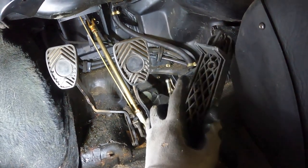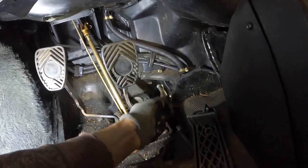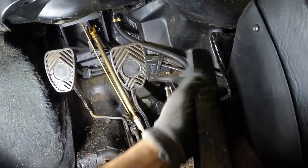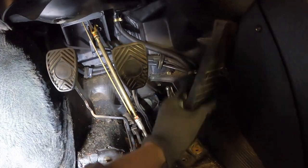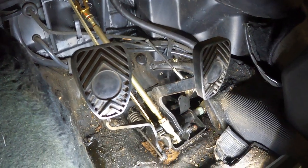Enough talking, let's tear these out. Here's your pedal — on the back of the pedal there's gonna be this spherical thing right here. That's what this goes onto — this is your pedal linkage. You want to pop that off; you can basically just pull this toward you and then unscrew the bottom here.